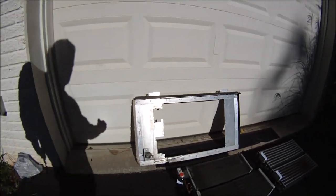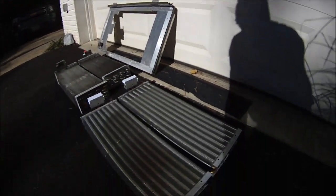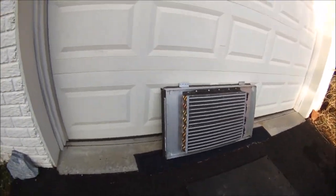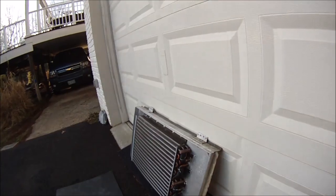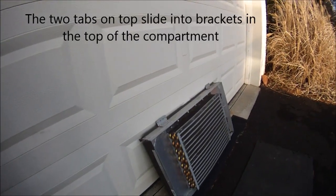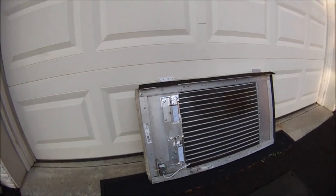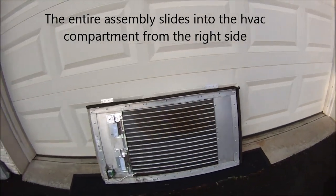We're replacing everything. We've cut out the housing, as you can see. These are our new evaporators we're going to put in. This is the exit side — two of them, eight inches by about 19 inches — put together on the rack I made so they would mount inside the original HVAC system where the original coil was. The original coil was the size of the outer part of this housing — pretty big and pretty heavy. And this is the intake side of the two coils for the evaporator.